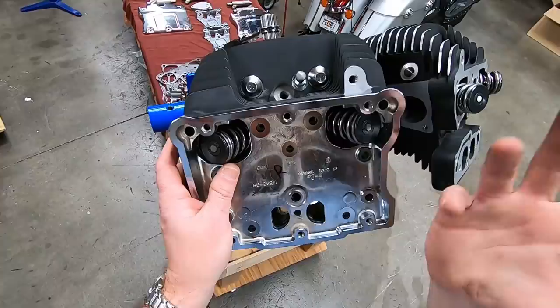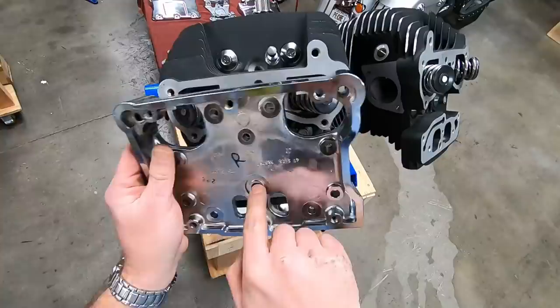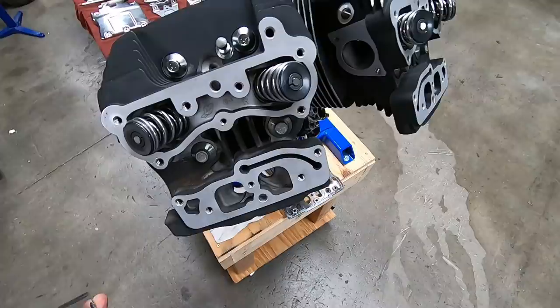That pressure then goes under the umbrella valve, through the filter element, through this hole here, and then passes through this channel out of your crank breather on the head, okay?